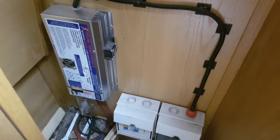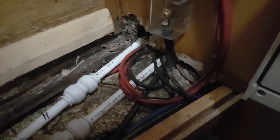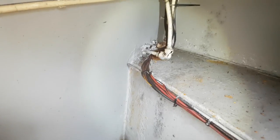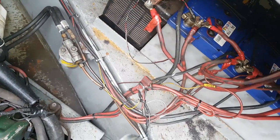Underneath here, the 12-volt cables go to the batteries, just connected to lugs. It's a pretty simple install. We have to get a stiff wire or some string, push it through, tie the cables on, and pull them through. If we can't do that, we'd have to drill a new hole in the roof and fit a cable gland — but I prefer not to, because the mushroom vent is right next to where the cables are coming out, so it makes sense to use it.